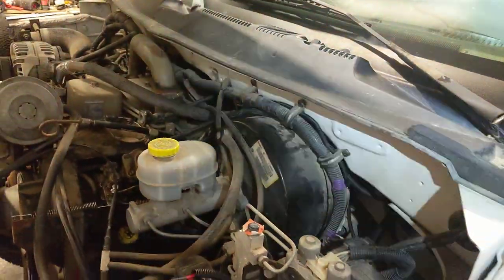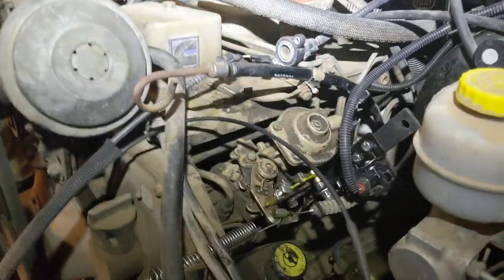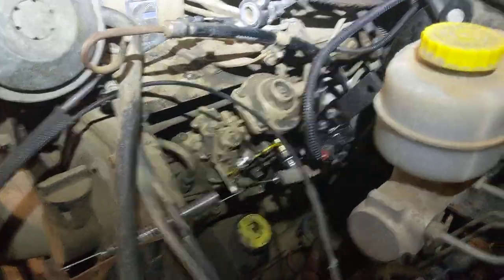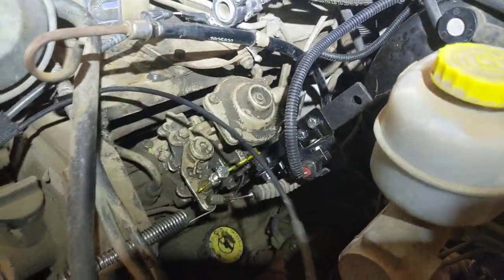So kind of a little quiz here — they kept the original 47RE. That 47RE is an electronically controlled transmission, so looking at it I saw, well, how is that going to work if they didn't do a standalone controller or try to fake out some of the inputs that the transmission needed?